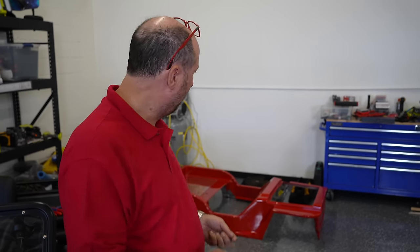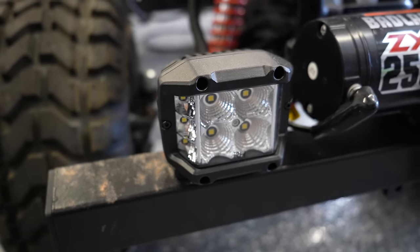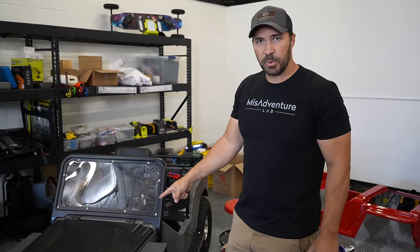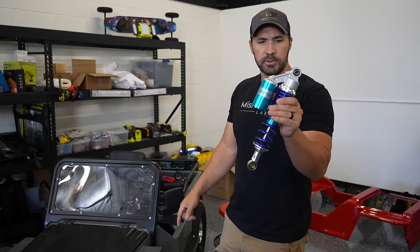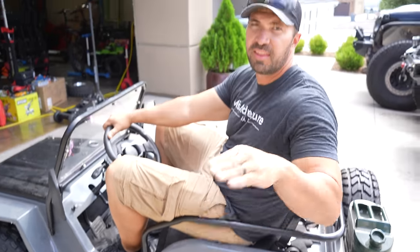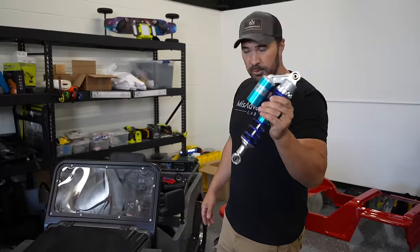Today what we're going to try and do with mine is get the beautiful Robbie Layton painted body back on it, which means finishing up with these Harbor Freight lights and finishing up wiring the winch that Harbor Freight sent us, then just buttoning it up. I'm going to get the suspension swapped out — going from a 10-inch coilover to these 12-inch coilovers with reservoirs, because when I sit on this, she rubs. That's a personal problem, but we're going to fix it with these bigger coilovers.